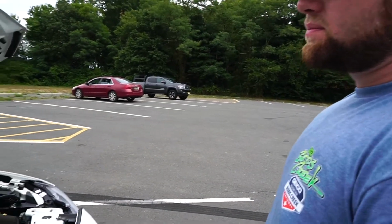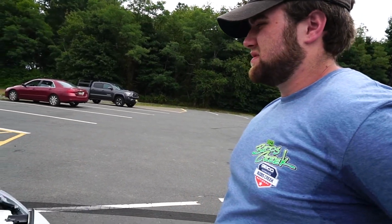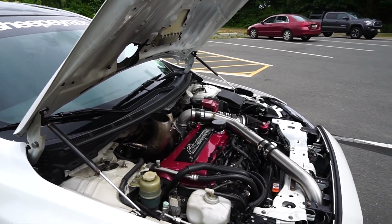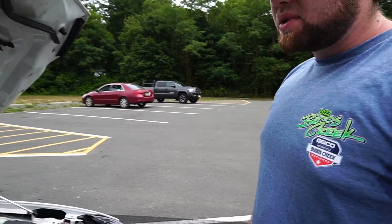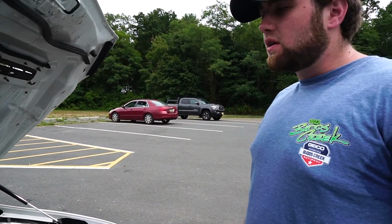That's what you're planning on doing? Probably over the winter, yeah. Do a dual wastegate setup, so it doesn't creep up like that, because the one wastegate gets hot. You couldn't tune it to make more, right? No, the wastegate spring was only an 18-pound spring, so you could only really go up to 38 pounds. Anything more, it would fall off the top end.